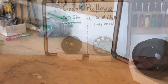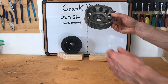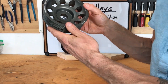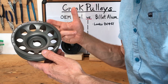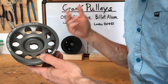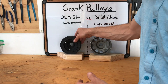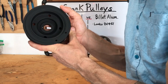The second item to evaluate is weight. The billet aluminum pulley is really, really light — I can lift it with my pinky. Ultra lightweight. What does a lightweight crank pulley mean? Basically it allows your engine to spin up faster, your turbo to spool up faster, and you get into boost sooner — so it can translate into quicker acceleration.